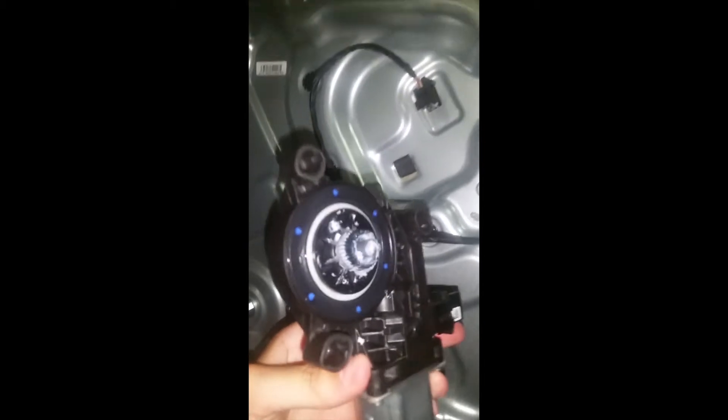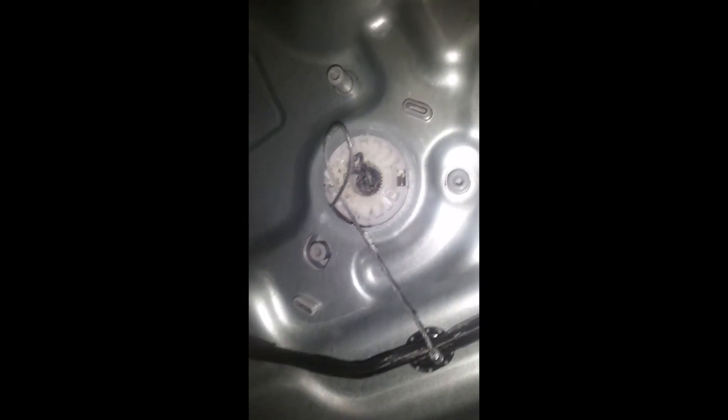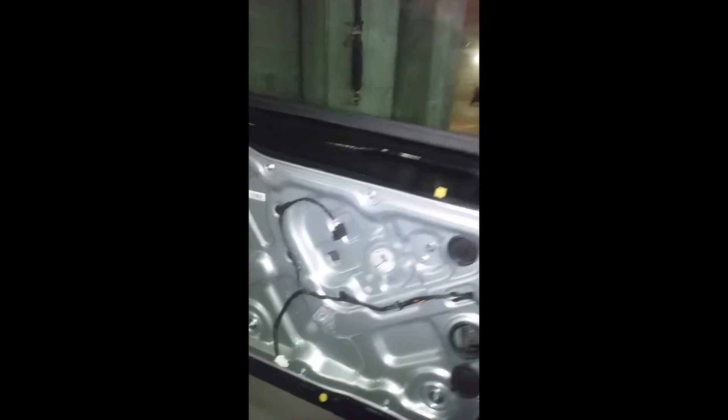I just took off the motor and you can see a whole bunch of wire inside that I don't think was supposed to be there — I have a feeling that's what caused the problem. With the motor out, we were able to push the window down and now we can see the two bolts we need to remove to get the window out from the holding.